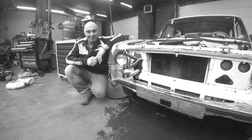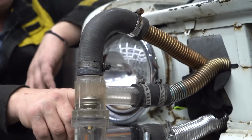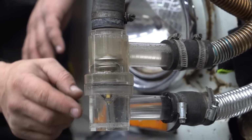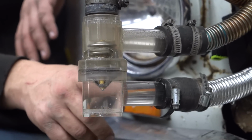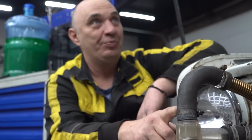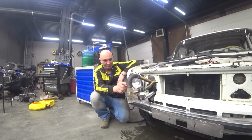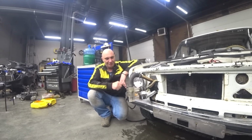As for what was about to happen, the way the fluid was circulating, here we have the endpoint, this is the out, and once the thermostat opens, obviously it's going to open up the large circle, but it's also going to block off the flow through here. In other words, the thermostat isn't going to allow any circulation whatsoever. And so these two tubes, we're gonna have to swap over ASAP.